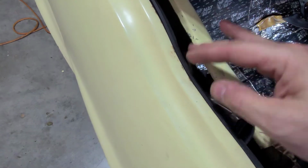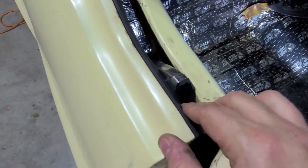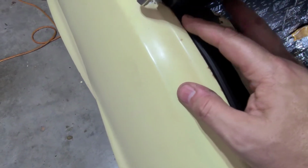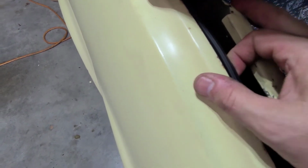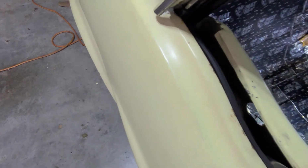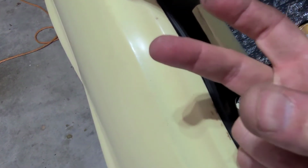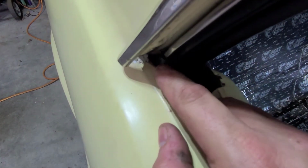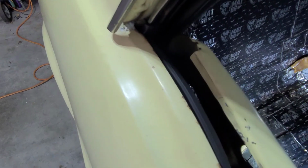Check your alignment on these studs, because they said this window, as long as this part's out, you've got a lot of play. You can fit it in there pretty easy. But initially when I got mine in here, the back pin was too far back and wouldn't get into the hole, but others had snapped in. The holes these clips go in are elongated, so you've got some play to move it back and forward. Now you can see it's meeting up to the roof line weather stripping we put in the last video. So this is going good.